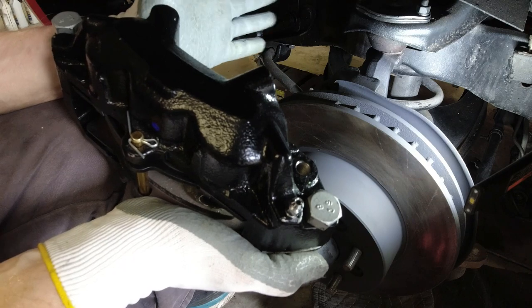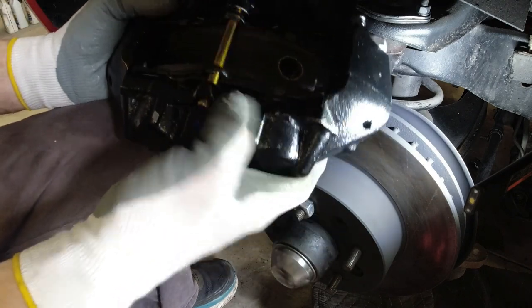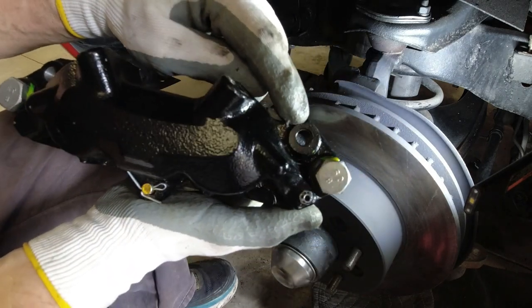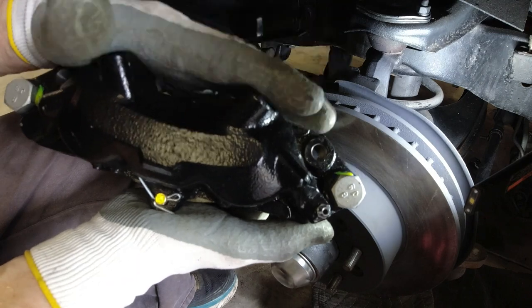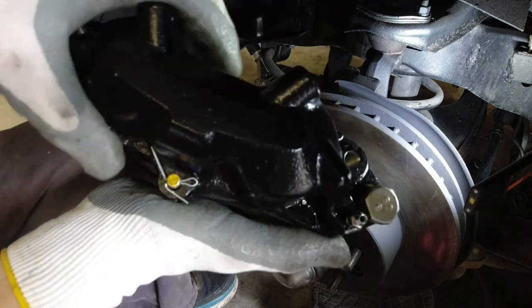They work fine from the factory, and the neat thing is they already came pre-painted. The downside is the mounting holes had overspray in them — I tried my bolts and they were tight, so I had to run a tap through the four mounting holes on both calipers. Got those cleaned out, and I've got the pads installed.